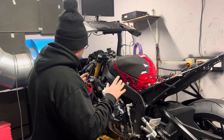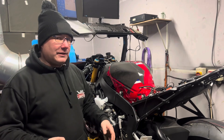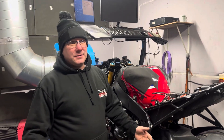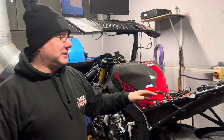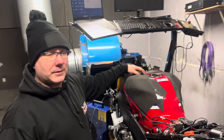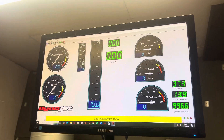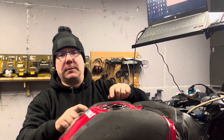As promised, and I don't think I've done this before, I wanted to show you the setup on the bike - basically to show what we have to do to get these things mapped, because I think everyone thinks it goes through these magic doors and just makes a bit of noise. When in reality, this one's stripped down because we're doing some other work on it, but for your average road bike it could be anywhere between 20 minutes up to a good 40 minutes just to get to a point where we can map a bike, because some ECUs are located under tanks, some ECUs are located in security cages. Looking at this bike, we've got the ECU under the tank, so if we want an RPM pickup we have to get the tank cover up, find the wire on the ECU, and that gives us our RPM. If I put the computer on, you'll see the tach dial there, and if we were to start the bike you can see the RPM registering - that's basically just telling the dyno what RPM the bike's running at.